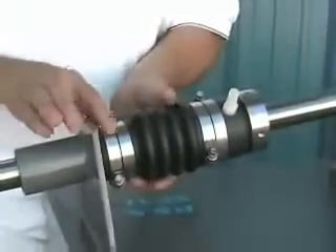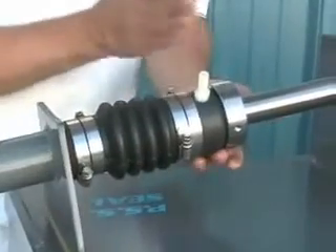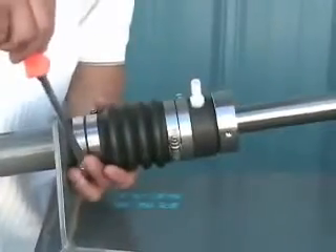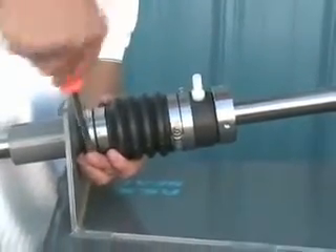You may also wish to position the bellow onto the stern tube to ensure that those faces are flat and aligned with each other. At this time you're going to tighten the hose clamps to secure the bellow to the stern tube.